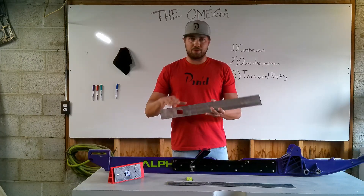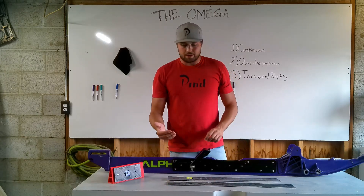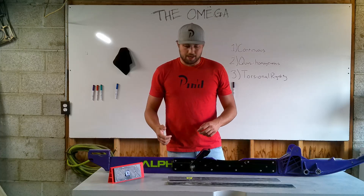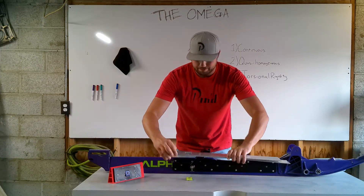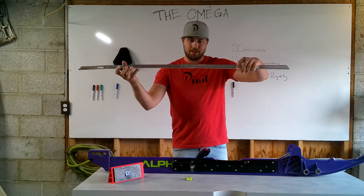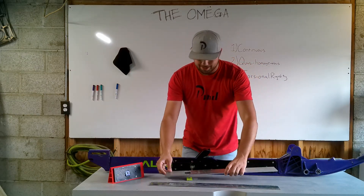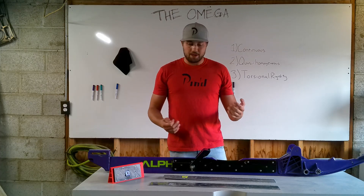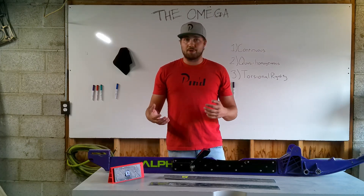This is a piece of 3/16 by 3 — you could go up to a quarter inch. However you want to look at it, it all comes down to how much you've got to mill off of that back side, and those square corners create stress concentration. You can mill that back side, or you could even build it up with another piece of sheet metal behind it. But when you do that, that's even less continuous because you're using two pieces and they just don't work together in the same fashion. So it's not a single continuous member because it can't transfer the load from the rear to the front — your weakest point is right there at that mounting block, and you're only as strong as that thinnest point in your rail brace.